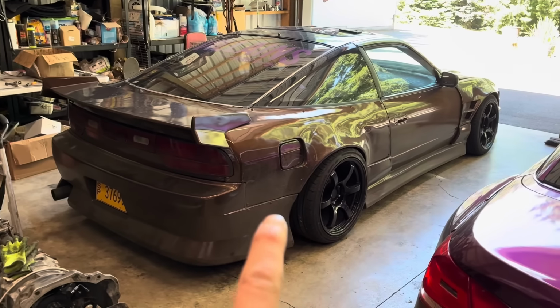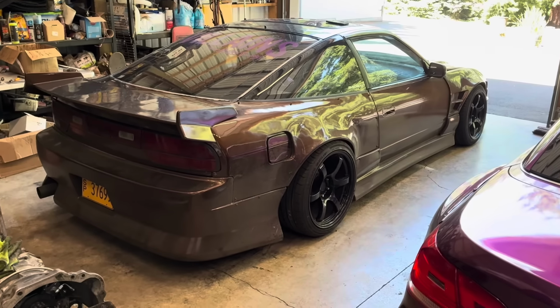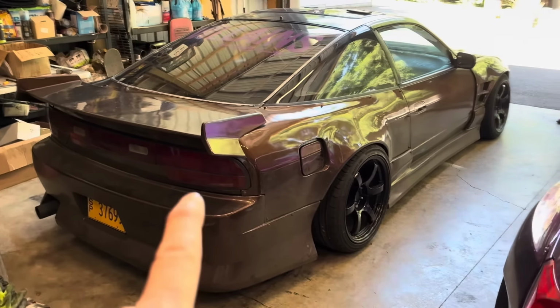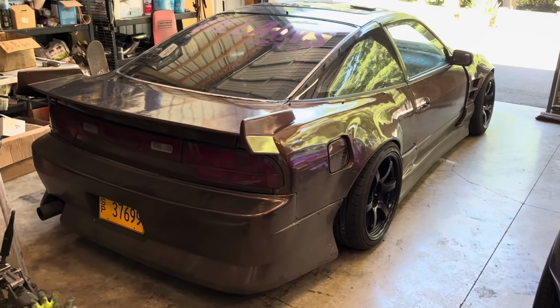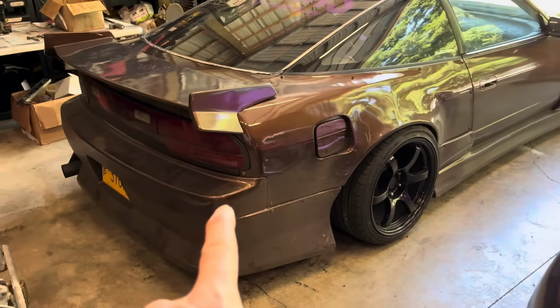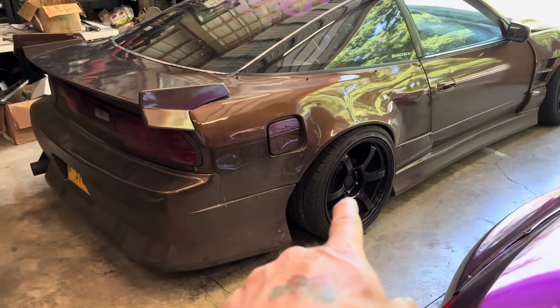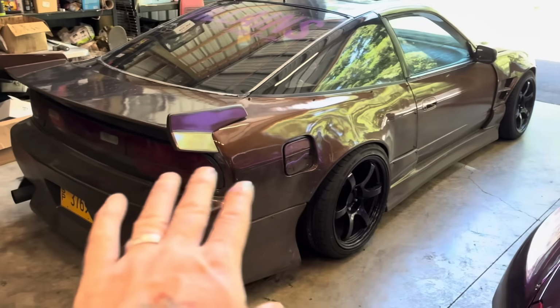So the VQ car, I did pull the tank out again. And while we were gone camping all weekend, I let it soak and did a much better job the second time of treating it for the rust inside. So I put it all back together. I also had a loose wheel bearing on this wheel, so I tightened that. And it should be good to go.